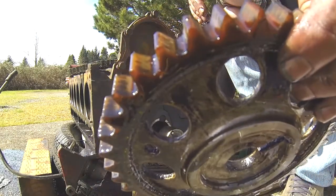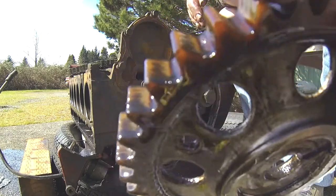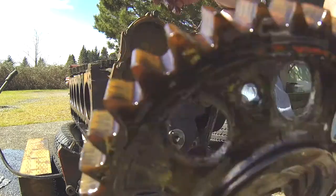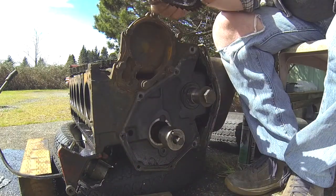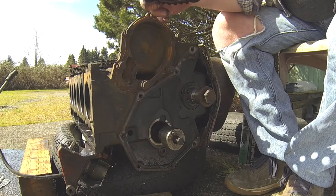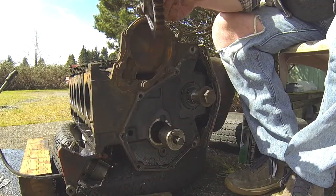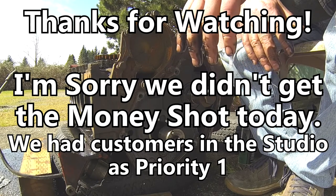I was thinking these look a little too transparent - you can see the light through them. It's some kind of phenolic, plastic-ish gear on that thing. I've never seen one before. That's what makes it so light too. When I took it off I should have noticed it's nothing like the one I had. Strange - not on the cam. It's kind of neat, but it's got to fit on there in just such a way. How does that not slip? I guess it's peened over on both sides - it's a pinch fit. Fucking weird. Some high technology for the inside of a 50-year-old engine. That's been replaced a couple times, I'm sure.